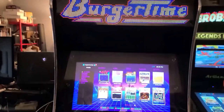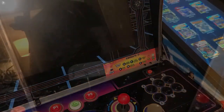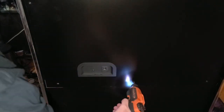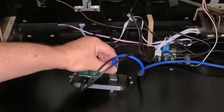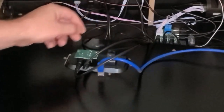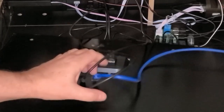At this point I had the Bit Pixel installed. Regardless if you do or don't, start by powering off the ALU, then disconnect the power at the back of the cabinet. Remove all the screws except the one at the very top middle, then remove that last screw and gently bring the back panel towards you — be cautious as there are three wires connected to it. Unplug the blue ethernet cable and the two black power cables from the panel and set it aside. If you had previously installed the Legends Bit Pixel, go ahead and unplug it and remove the power adapter and USB cable going to the Bit Pixel.